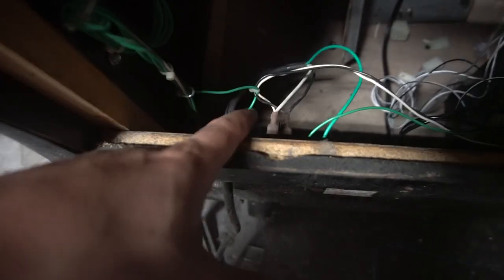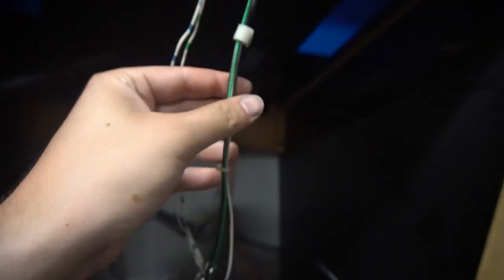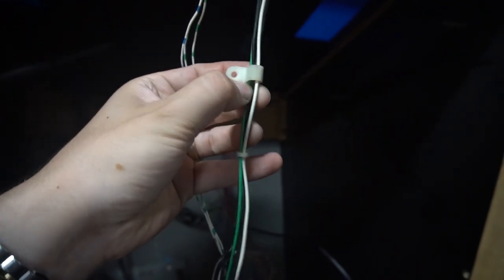While we wait for this thing to load, check out the marquee lighting. I don't want to make two separate videos. Basically we took out the power supply, cut the wire so there's absolutely no power on the old side at all. We took the existing power cord that came in and it splits out here — we brought it into our new power supply. With that, we have our light. It is a real fluorescent light, not LED. We do have our three wires going right into the power supply.